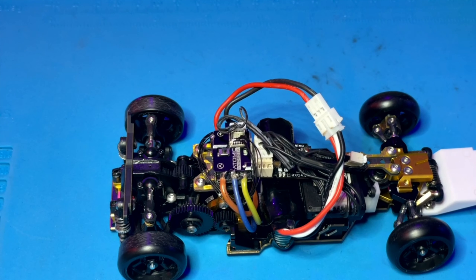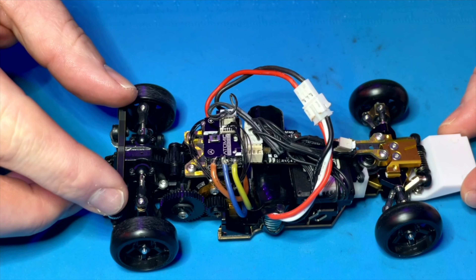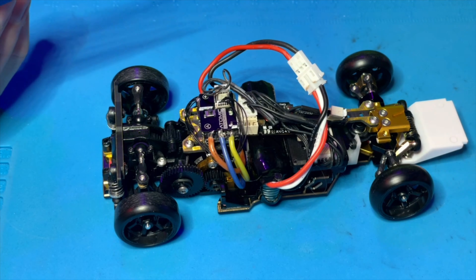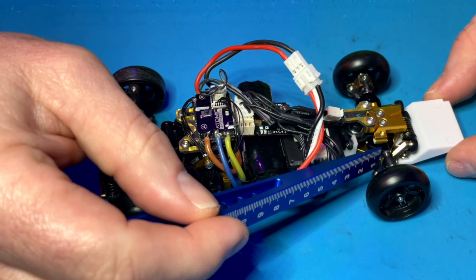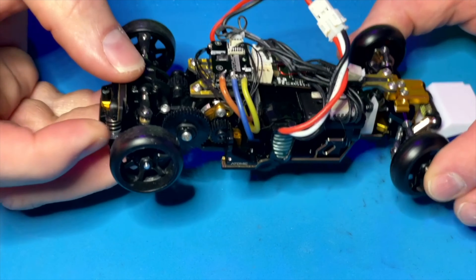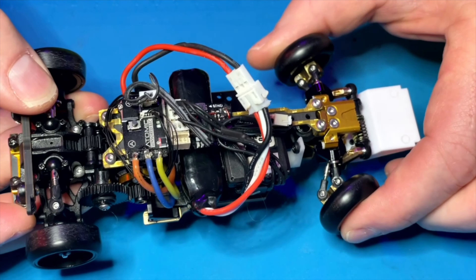In general, I think it went together really well. I got mine together in about four to six hours, depending on how you'd like to approach it. As everyone has mentioned, cleaning your plastics as much as possible before you get them installed, sanding them down, getting them fit just right, making sure there's no binding. It's also important to really work with your cups and your linkages to make sure they are nice and loose on the balls — you just have to work with them a little bit so they get as loose as possible so there's no binding anywhere in that turning radius.